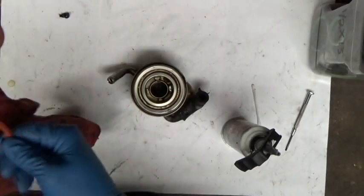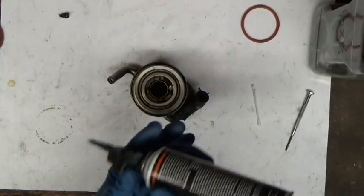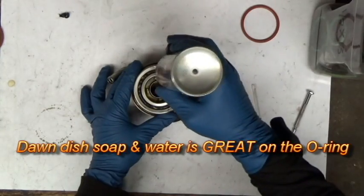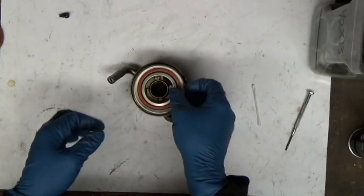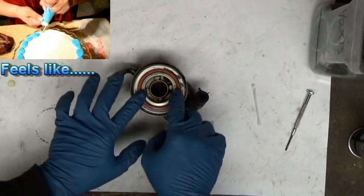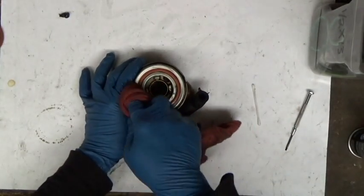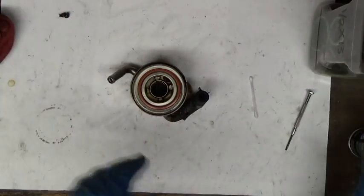Get everything really nice and clean — clean the channel that the o-ring goes in, clean the o-ring, and make sure there's no oil left on it. It takes a little bit of chemicals sometimes: alcohol, glass cleaner, brake cleaner — though I wouldn't use brake cleaner too much because it can cause o-ring expansion. Get it clean so that the gasket maker sticks to the o-ring and get the surfaces clean so the gasket maker can stick to the sealing surfaces. When you do this it feels kind of like you're a baker putting frosting on a cake, being careful to get it just right. If you put too much on, you risk having it get into the oil filter or cooler — there are tiny little ports and passages you do not want blocked. Make sure you have a continuous ring that isn't going to lose a piece here or there.